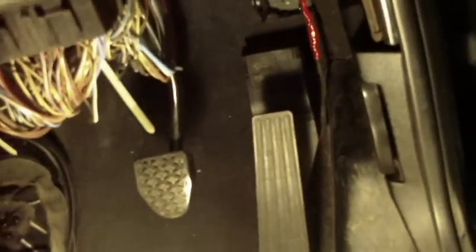Hopefully you'll be able to see — a very easy job to get the throttle pedal in there. It's bolted in on the floor and to the bolt behind where the old pedal stop was. Got a very nice feel to that, it's very solid, it's not going anywhere. The next part is just to hook up the signal cables to the controller and that'll be all done.